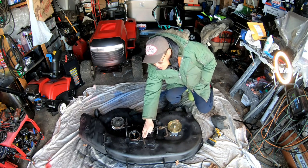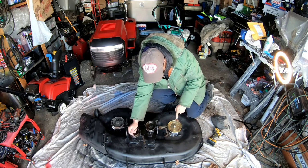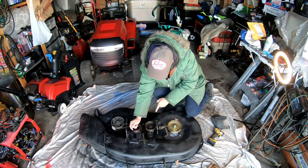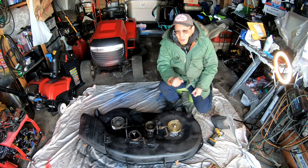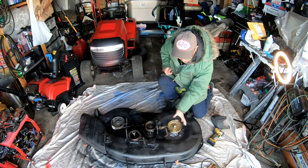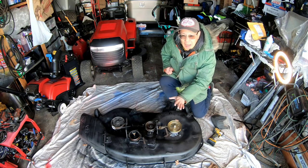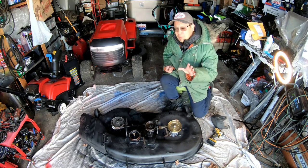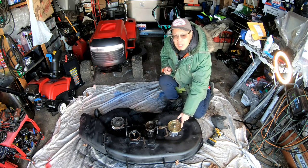And we added another spring on this one here. Everything's in order - the brake releases both pulleys when it's engaged, and when it's disengaged it stops the pulley. I noticed something else that was missing as I was looking at the old deck: it doesn't have a guard for this pulley. On the Craftsman LT-1000s and that family, there's only one guard, and it's on the left one if you're looking forward.